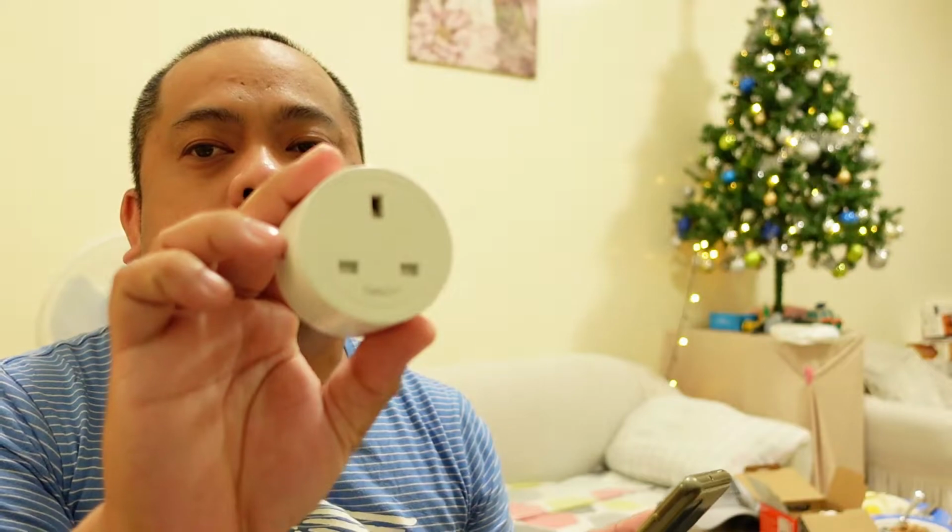So I'll just check. I have several Wi-Fi at home. It should be 2.4G, not 5G. This is compatible with 2.4G, not 5G. It's an old model, I don't know why. Because 2.4 you can reach at a distance. 5G is fast, but it's not able to penetrate that much, the coverage is less and it can't penetrate walls. So it's up to you.